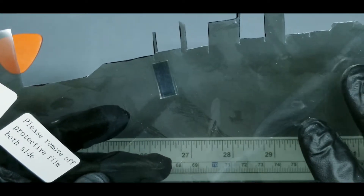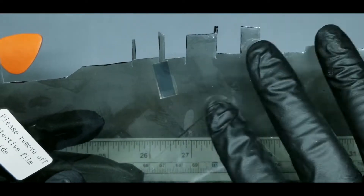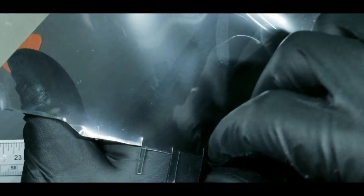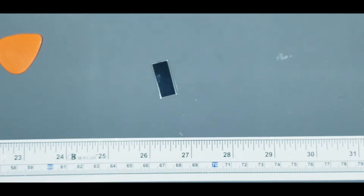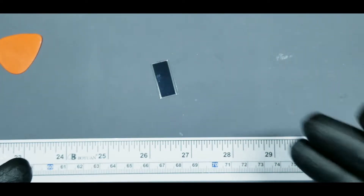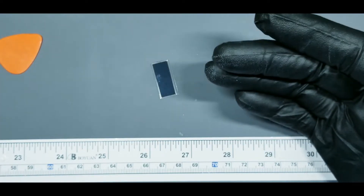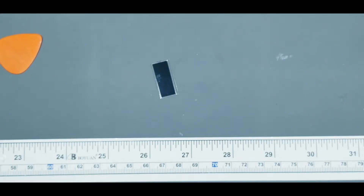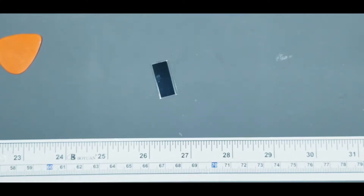This polarizing film is adhesive — it's kind of like a sticker. The front is non-sticky and faces you on the watch. The back has a film covering a sticky side that sticks to the screen. Whether you use adhesive or non-adhesive polarizing film is up to you. If you plan to reverse this process later on, it's probably better to use non-adhesive because it's easier to remove and reverse.